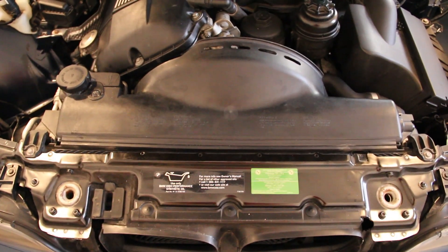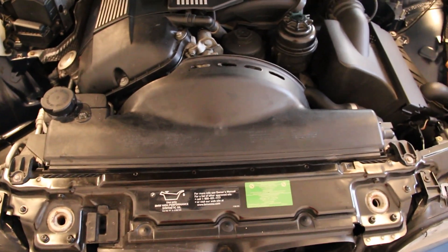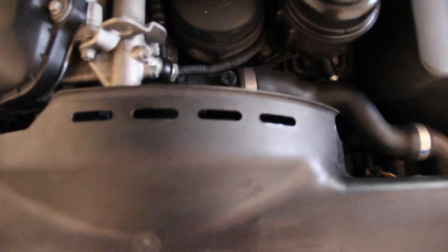The first step to replace those is to remove the fan shroud. The first thing you really want to do is remove the fan — you can see the fan clutch right down there. You're going to need the fan clutch tools; I believe that's a 32 or 34 millimeter bolt on there. You can pick those up on eBay for about $35. They can become very useful for owning these cars, so definitely look at picking one of those up.